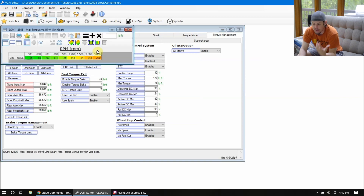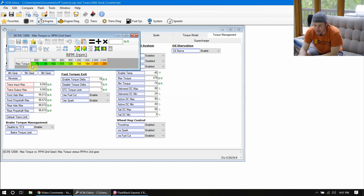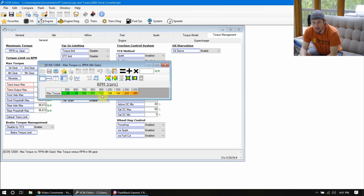There are also adjustments on the individual gears. On this Corvette it stops at 3,000 RPMs at 280 foot-pounds of torque. Similar to the virtual torque table, if you need to bump this up, you really only need to focus on the 900 to 3,000 RPM range — you don't need to worry about 800 RPM and less, because your car is probably running around 700 or 600 RPM idle and we're not really concerned about a lot of torque off idle. These tables aren't that important.